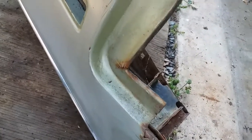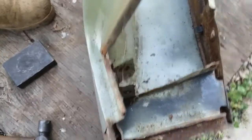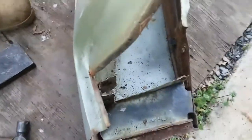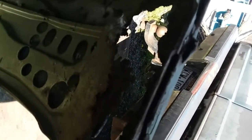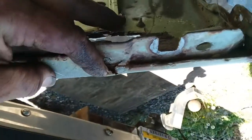I know this isn't suspension related, but we pulled the fender off on this end because I'm still waiting on parts to get the other side done. This got hit up in the front and it compressed this a little bit. So what I'm going to do is attempt to straighten that out — not going to do any extensive body work, but I do want to get that straightened out a little bit so it fits around the headlight better. Give you a better picture of how bad the damage is on this fender, especially from the inside. It's pretty bad. We're going to be welding that up with some actual metal and not Bondo like the last person did.